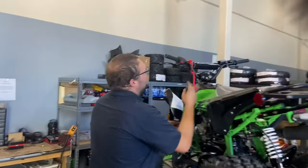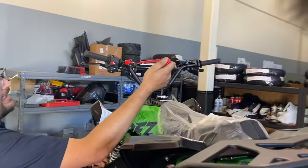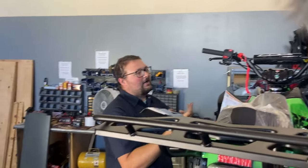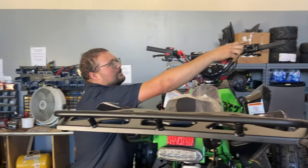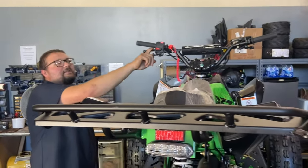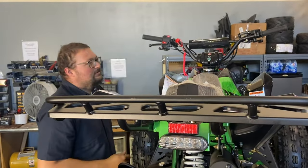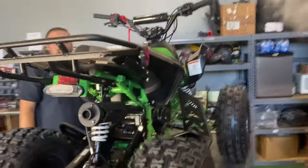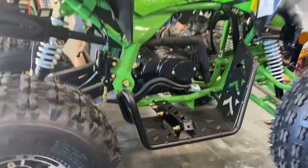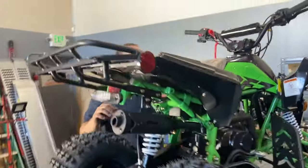Basically, you want to make sure you have your lanyard in on your ATV, make sure your choke is outward to start it, and then you want your brake engaged. Then hit your starter button, which is on this side on this Apollo. Sometimes on some of the other Chinese ATVs you can also step on your right foot brake as well.